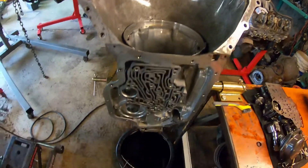We've got it all cleaned up and ready for reassembly. Before I start sticking parts back in the case, I'm going to hose it off with brake clean really quick. I like to do that because brake clean evaporates quickly and I know it'll flush anything I may have missed, or any parts washer solvent that's still in there. Then we're going to start doing our shift kit and putting this thing back together.